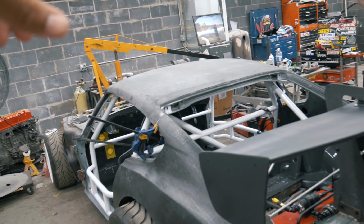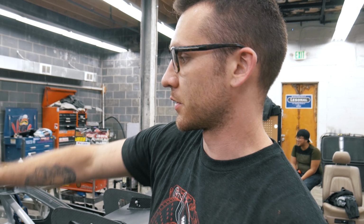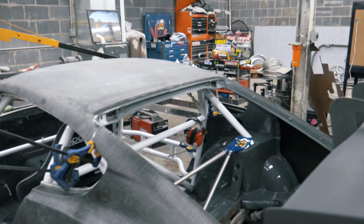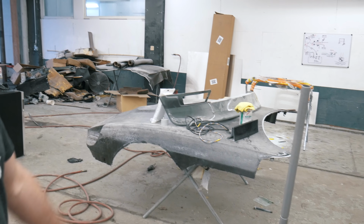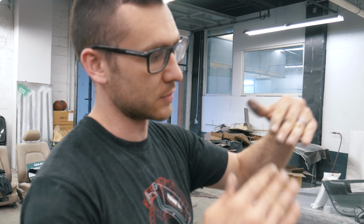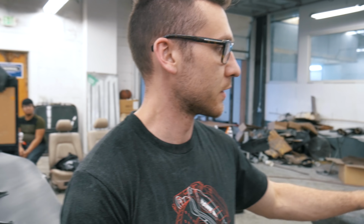Quarters need to be sanded. Another coat of resin. Another layer of carbon fiber across the whole thing, getting rid of that seam. Another coat of resin, sand it flat, clear it, done. Same thing with the hood. The hood has got three layers on it. It needs one more. But I'll straighten out the hood a little more since it had a lot of panels that overlapped, layers that overlapped, and they got a little big. So I need to cut it down flat, make sure it's all straight, do the last panel.